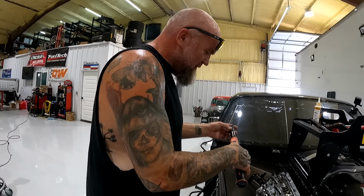So in those rockers, when you test them, do you just make sure they're smooth? Yeah. When we check these, you'll roll the roller and make sure it doesn't drag anywhere. And then also the rocker, you make sure it slides in and out easy. And then also check it for up and down play. These all should be pretty good. Yeah, they are, I checked. Put it on the gun.